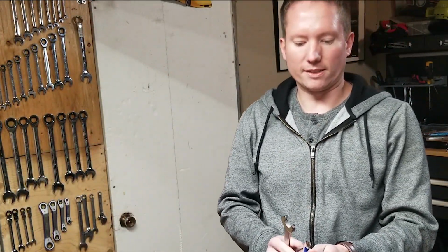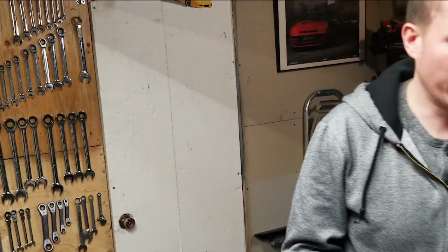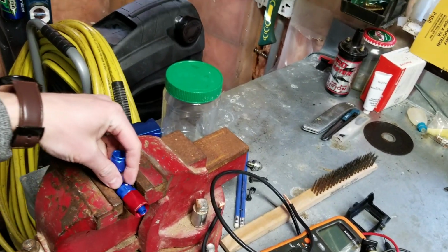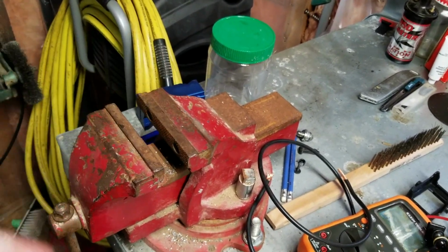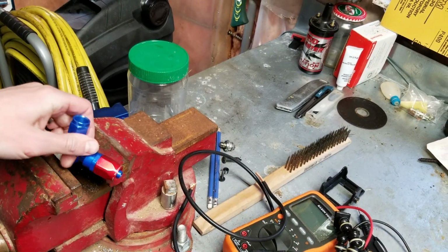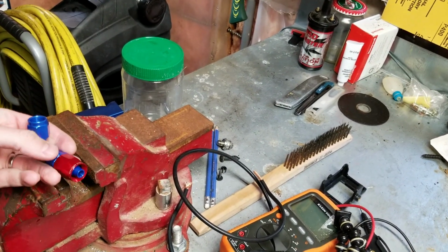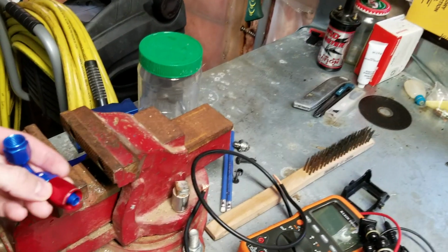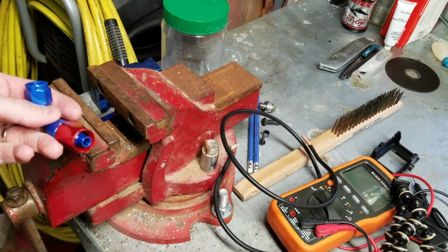So then the other idea was just to use a standard vise, such as this. So essentially, just put your fitting in there and tighten down the vise, and then that'll hold your fitting into place, as you can then apply pressure with one hand, pushing the hose in, and then using the wrench to tighten down this fitting piece.